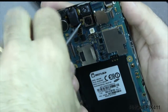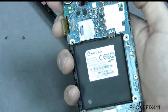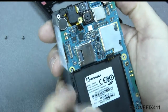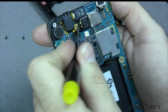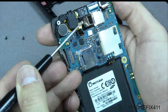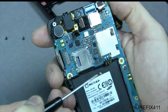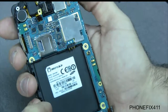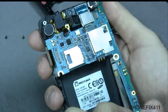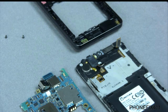Take out the top screw and the bottom screw. For the camera, get down into the crack between the board and the camera and use the pick to pop it up. Be careful not to damage the camera or its housing — that's why I use the really fine-pointed screwdriver to get into spots like that. Once everything is released, pinch down at the bottom near the charging connector and slowly wiggle the board up. Once it's wiggled up, slide it down and out — and that's how you disassemble the phone to get the board out to start on repairs.